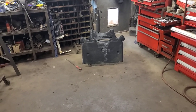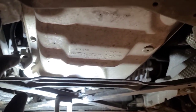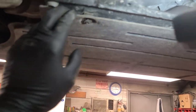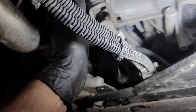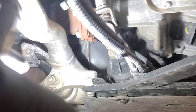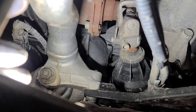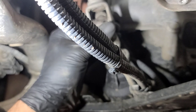You need to remove that plastic shield — there are three retaining screws in the back here, plus you've got to drop this corner screw and pull two plastic push pins out. Now that universal joint I'm talking about is right here. I suspect one of the crosses is rusty in there. Although it doesn't look as bad as you'd normally see, it doesn't take very much.